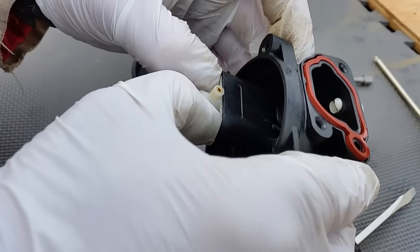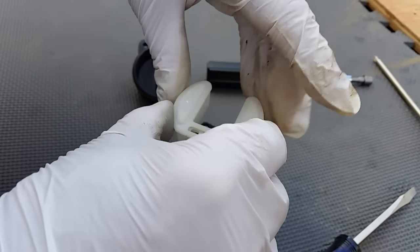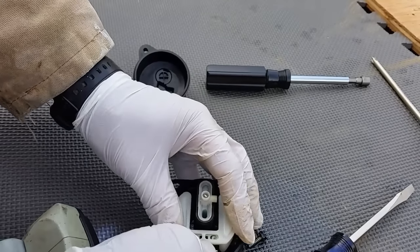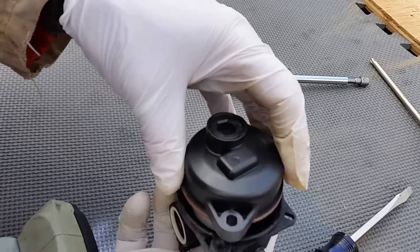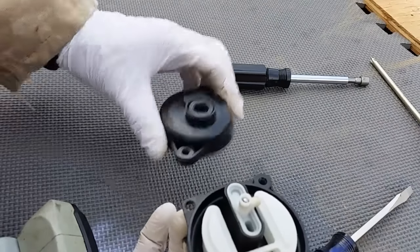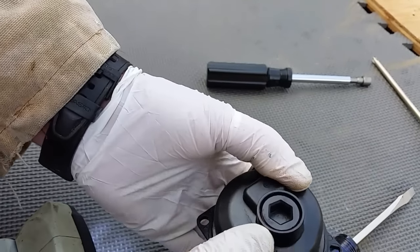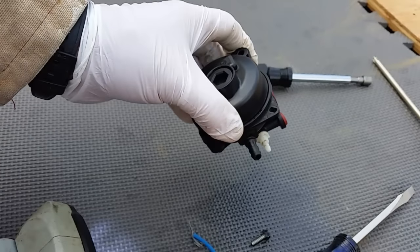Real easy, and that is done. Set this back in and put this back together — most of you playing with this know exactly what you're up to. I'm not sure it really matters which direction this slot is, but I'm going to go this direction because it's pointing the same way as this pipe, and it makes sense that it would allow fuel to come in. And that's it — this carb is back together and ready to go. Thanks YouTubers!